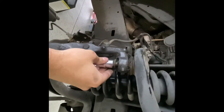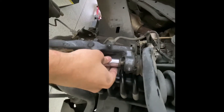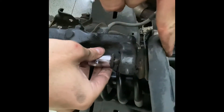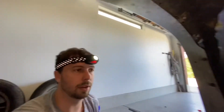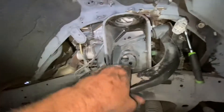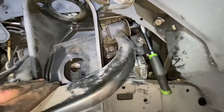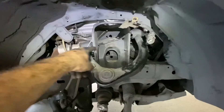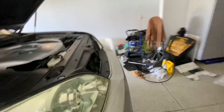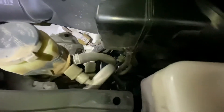So I just took this little cotter pin out of the castle nut right here. And now I'm going to — sorry, my whole family is coming through somehow right now — just take out this castle nut, 19 millimeter. Then we're going to work on separating the upper control arm from the knuckle, and that's going to take a couple whacks of the hammer. So after much finagling, I got this out of here. Now I'm working on getting this upper control arm out. There's a bolt that goes all the way through there. Wish me luck — this bolt goes all the way through and comes out right down there.